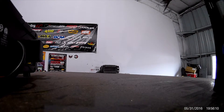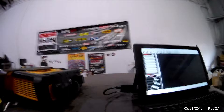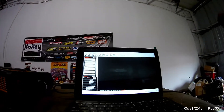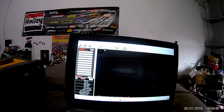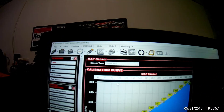I'll grab the tablet and open up the Terminator X software so I can show you what's different with mine. This is the Terminator X software — looks a lot like the V4, V5 — and this is my file that I created. Under sensors, this is my MAP curve. I did custom map up at the top, and this is my curve for a Duramax — it's kind of a three and a half bar sensor from what I understand.